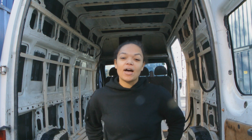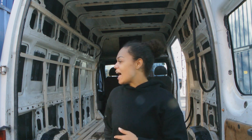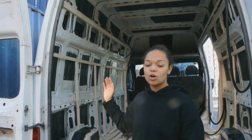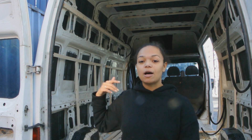Good afternoon everyone. Today what I'm going to do is work on the insulation because most of the structure is done now. I'm going to start with one wall just to see how it works and then take it from there. Just to let you know what I've done in preparation — there were a few holes on the side which I've filled in with silicone and they've completely dried, because when I put the insulation in I don't want there to be any chance of condensation or air getting through to help cause condensation.